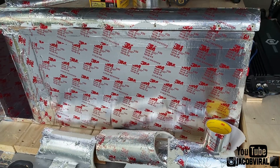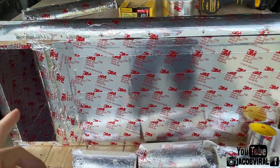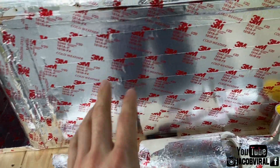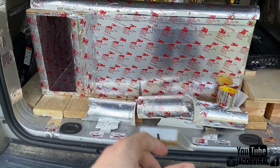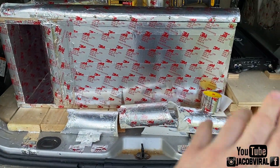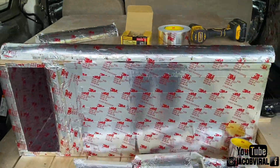That's all I got in this video. Thanks for watching everybody — like the video, subscribe, and I hope I taught y'all something today about how important it is to have smooth surfaces and roundovers on your subwoofer box edges. Don't worry about how it looks — it's not the prettiest, but it works. Look into your subwoofer box — wall, ported, or sealed — and if you have any sharp edges, smooth them out. Use a router, sander, sandpaper, or like I do, PVC pipe. Also, inside the enclosure corners, adding something there can eliminate dead space where air gets stuck. I'll see y'all next time.